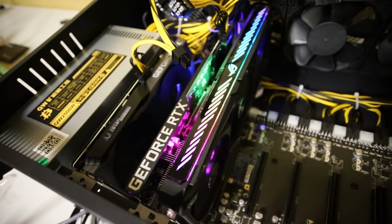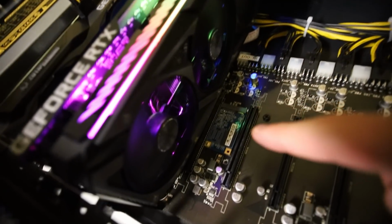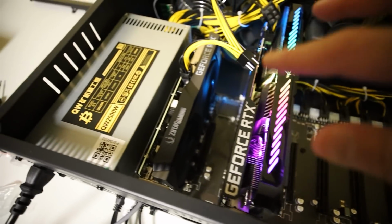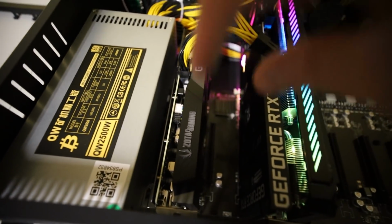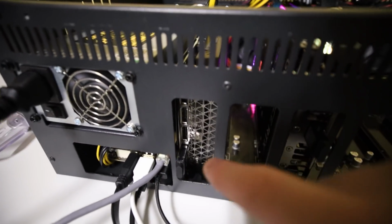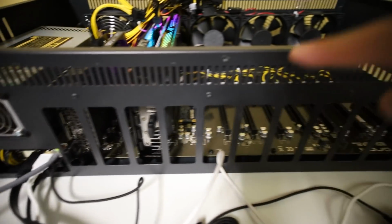let me know. Another issue I had with the Asus Strix is that it's quite big. The fan shroud is covering one of the PCIe slots. So potentially I could do 12 of these Zotac 3060s, because these are much thinner, they would fit in all of the slots on this motherboard. And then I would have to get another 11 or 10 dummy plugs, one for each 3060.